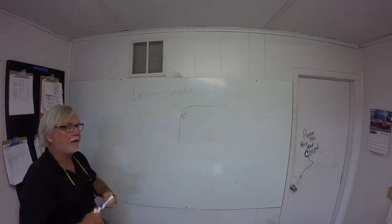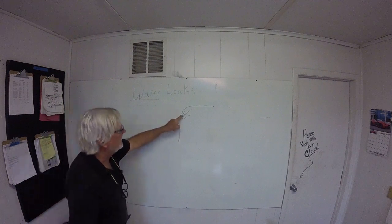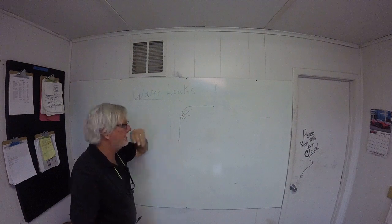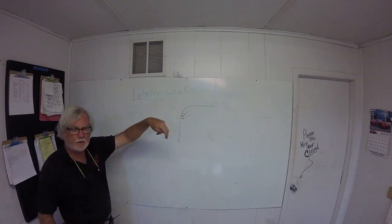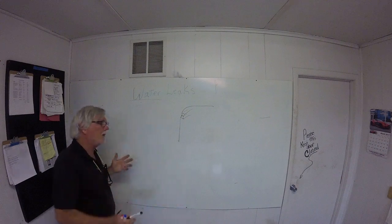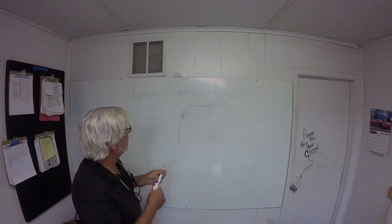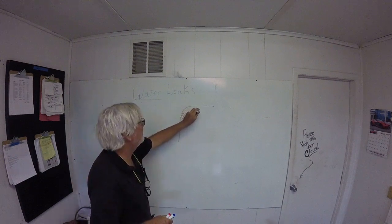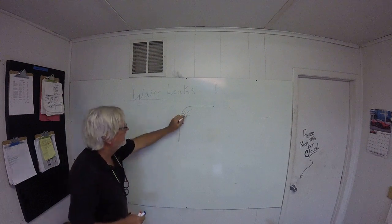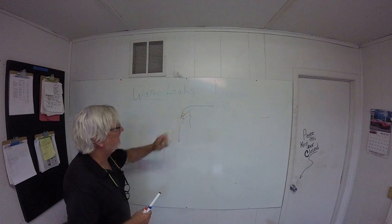So if there's a leak anywhere on any one of those screws, it goes right into that hollow, and it drops. If the coach is leaning to the back, it will drop right at the end of the cabinet, you know, in front of the speaker. In the front, it will drop right behind the driver, past your seats. And if there's a hole anywhere on the inside of the coach along that hollow extrusion, it'll leak there too. So this is very important.